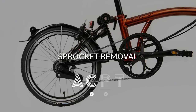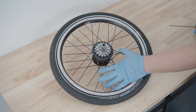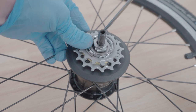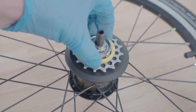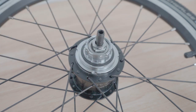Sprocket removal. Please note, sprocket removal for T and P-Line is different — see the link in the description. Remove the rear wheel before attempting this job. For more detailed information on how to do so, please click the link in the description below. Place the wheel on a flat surface. Then, using a flat-headed screwdriver, pop the circlip off the hub body. You can now access the outer sprocket, spacer, inner sprocket, combined cap, and slide them off the hub body.